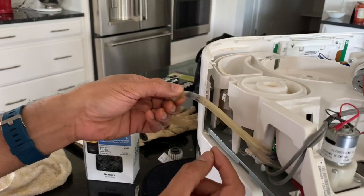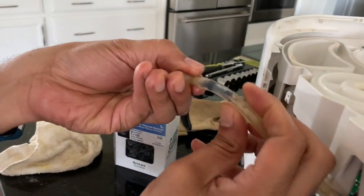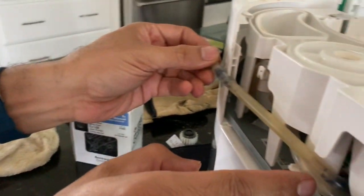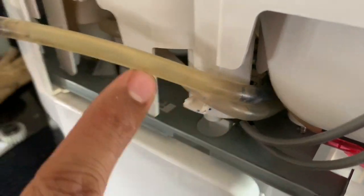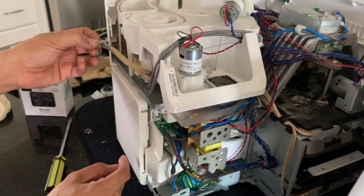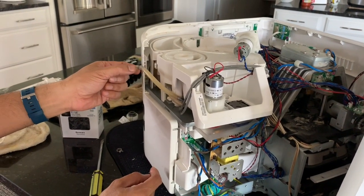I have opened the Rotimatic cup and I am looking at the water pipe line. As you can see there is mold in multiple places here, and also on the other side. I will try to remove the whole pipe, clean it, and then reinstall it. This machine has been used for almost two years, and it seems that after maybe one year the mold starts forming and you have to clean it.